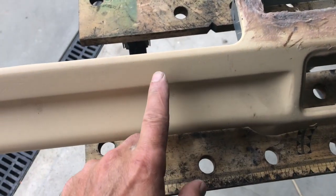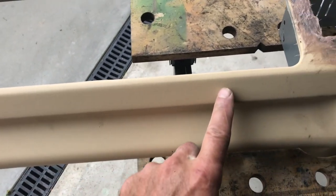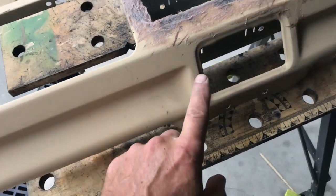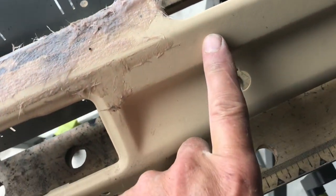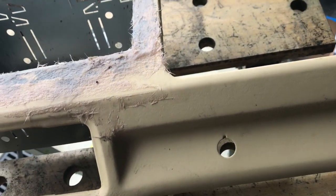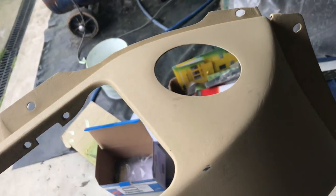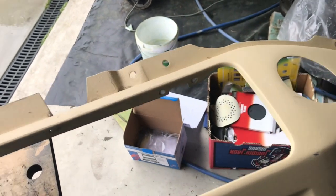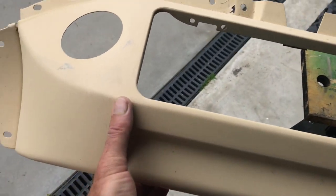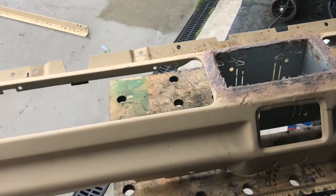These dashes are actually textured, so I'll probably have to give this another hit with some 2K primer and a really decent sand. You can see a bit of texture still in it — it's probably not going to be the easiest thing to get out, but I'll try to get as much of it out as possible. I don't really want to skim it, but I'll get some hard-build primer on it, sand it up and get it all back together.